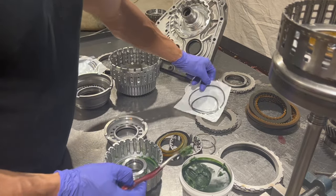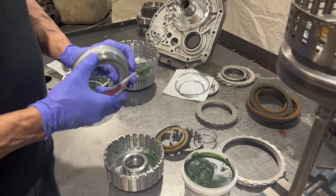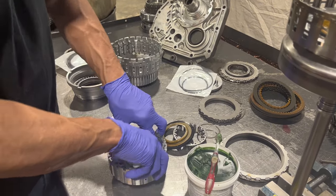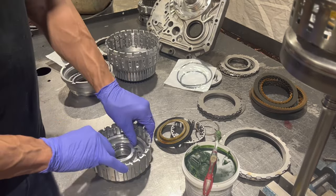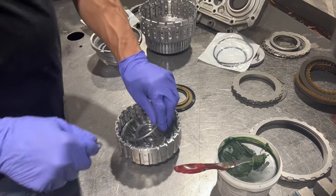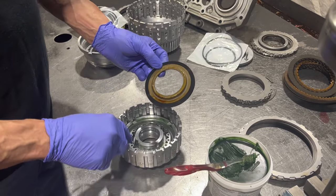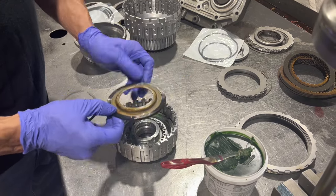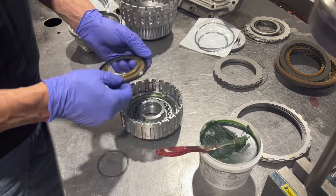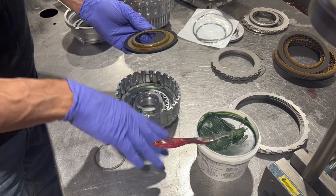If this isn't something you've done before, you'll notice the bags in the rebuild kit will tell you what seal is for what — so these are for the front brake. Most of these have balance pistons in them. There's a seal on the outside but not on the inside, so when these things get going real fast — in five, six, seven, and eight speed autos — the drums are turning real fast while the clutches aren't applied, and centrifugal oil underneath could start to apply the clutch. What this does is it also has oil, so the oil that centrifuges to the outside balances the other piston and keeps it pushed back down.